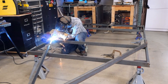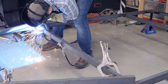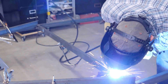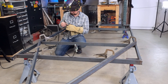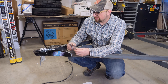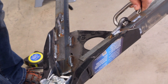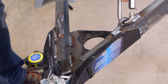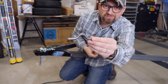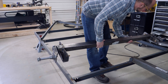The body can be mounted to any part of the frame, but I want to use the front channel for wiring, so I'm adding 2-inch by 2-inch angle iron for body mount points. Murphy's Law dictated I had to fix the welder before my very last weld — Murphy can be such a jerk. One thing all trailers must have is a set of safety chains. The best way is to weld chain stays to the bottom of the frame and use a locking carabiner through the stays and chains — that way if you need to replace chains, you can easily detach them without modifying the frame.